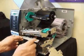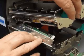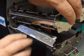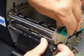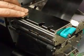The print head will be attached with two electronic clips like this. Disconnect the two electronic clips, reattach the new print head, close the print head assembly, and replace your two print head screws.